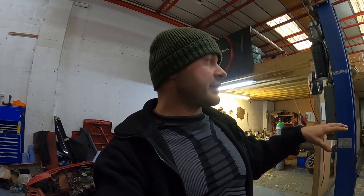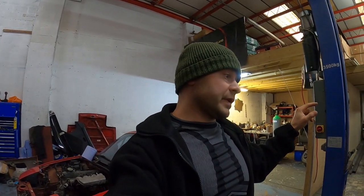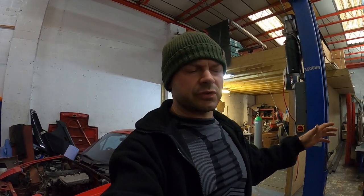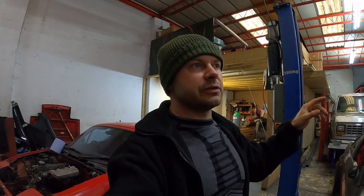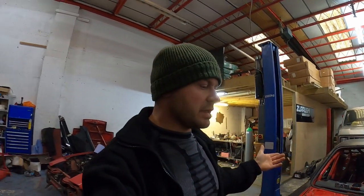These past 2 nights I've done a lot of stuff. I've fitted the drive shafts on the back, Skyline R33, because I'm bringing in a Skyline diff, because the original one is not strong enough. I have the full transmission now. I fitted the clutch lines. I have to bleed it, probably tonight, if Steve gives me a hand, because I need 2 people to bleed the clutch. Well, it's easier.